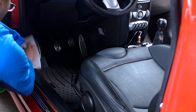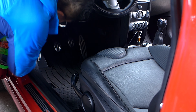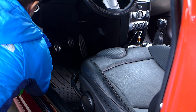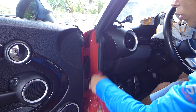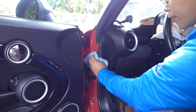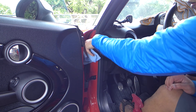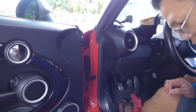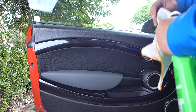Since you're down here, I'd suggest applying some rubber protectant into the molding that surrounds the door aperture. If you want, go ahead and do the same for the footwell plastics that surround your pedals. Feel free to reach into your foot air vent and clean any dust off as well. If there's another place the regular car owner forgets to clean, it is the door jamb. Here leaves, greasy gunk, dust and mud can collect over time and affect the lubricity of the door hinges and door checks — those little things which allow you to stop your door in various widths. Just spray some detailing spray when cleaning this part, and use a paper towel if you find heavy grease around the hinges only. Don't touch the grease on the hinges.